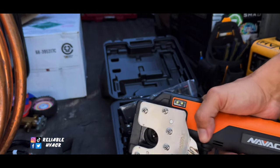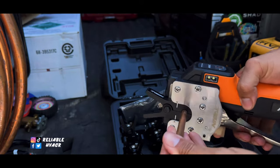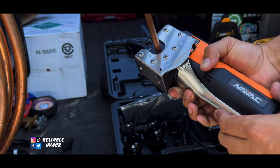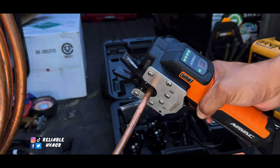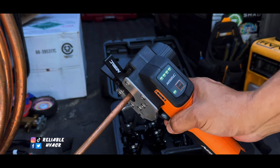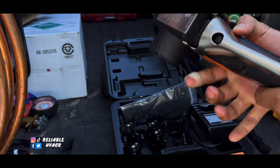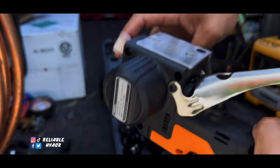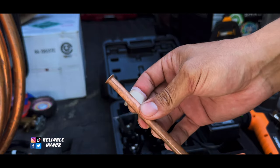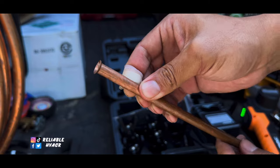Here it is being redone. We've got it in there clamped — when you push it in, the lever gets out of the way. All you do is clamp down that big silver lever at the bottom, push the button inside, and let it do its thing. Once it cycles — all the way in and all the way out — you pull the lever out to unlock it, take the pipe out, remove the clamp, and there is your flare. Pretty damn good, very clean and shiny, even on old scrap pipe.